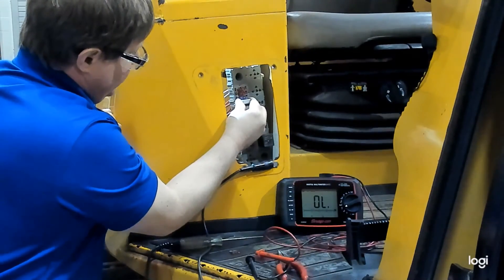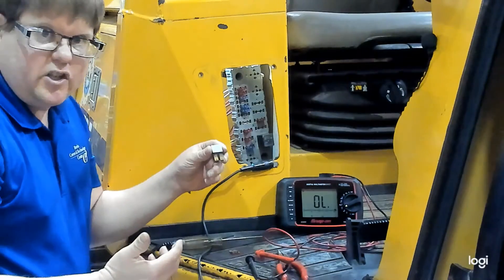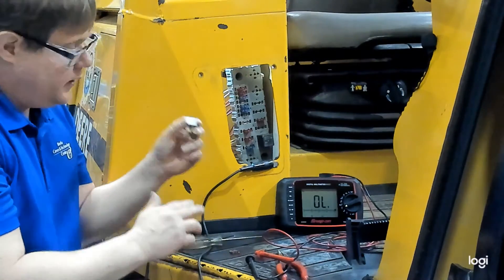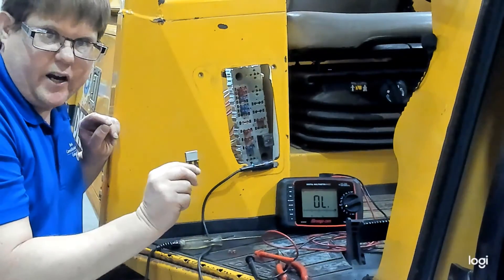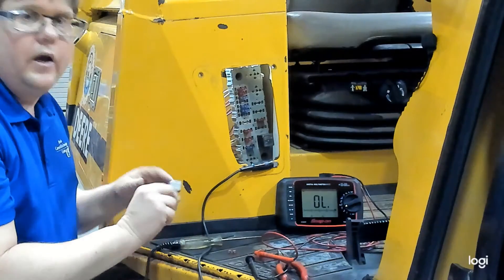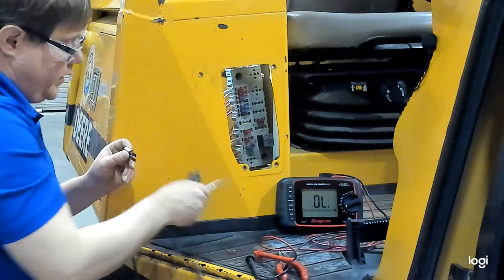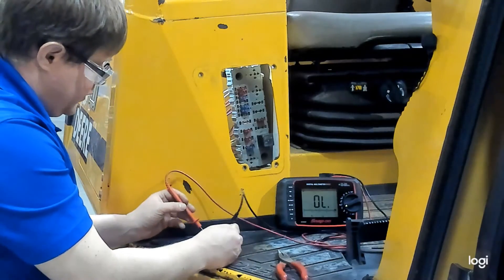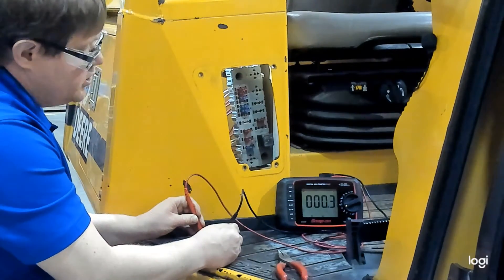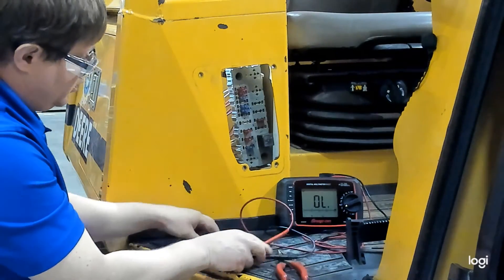You'll notice I skipped over this silver one — this is different. This is not a fuse; this is a circuit breaker. It doesn't have an opening on the back. It still serves the same purpose as a fuse. The difference is that fuses are one-time use — once they blow they need to be replaced — but circuit breakers can be reset. Some will reset automatically like we have here; others might have a manual button or might reset when the key is turned off. You would test the circuit breaker the same way using an ohmmeter. We're going to take our multimeter and put it across each tab. You can see we have low resistance and you can probably hear that audible beep as well — so that circuit breaker tests as good.